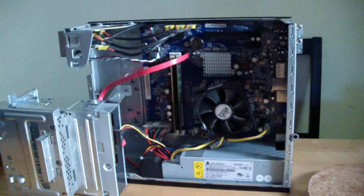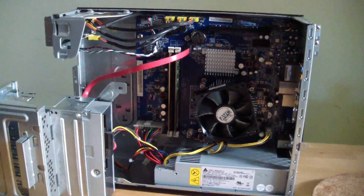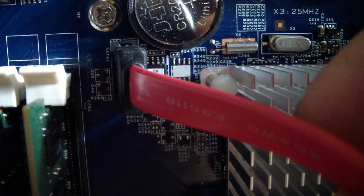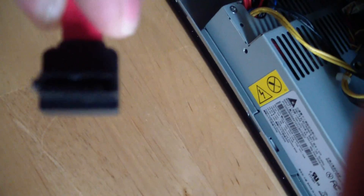First you take the hard drive out. I recommend taking a picture of what it looks like before you start messing with it, so that you'll know how to put it back together if needed. To know what kind of connectors you have, look at the connector on the motherboard — it says SATA, so it'll tell you what kind of connection that is. Most modern computers are going to have a SATA connection, which looks like this on the hard drive, and the cable looks like this — a little cable with sort of an L-shaped groove in it.